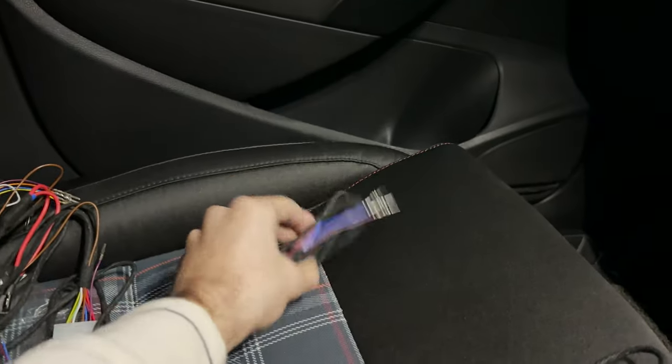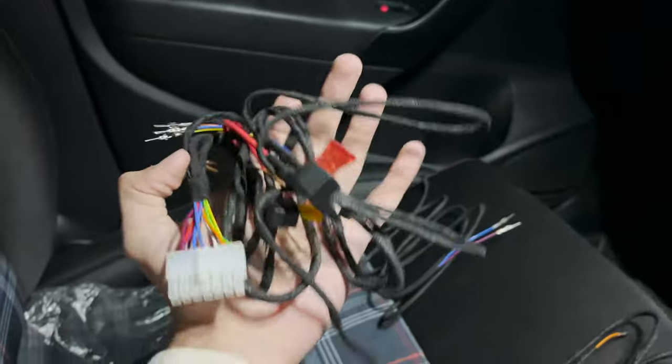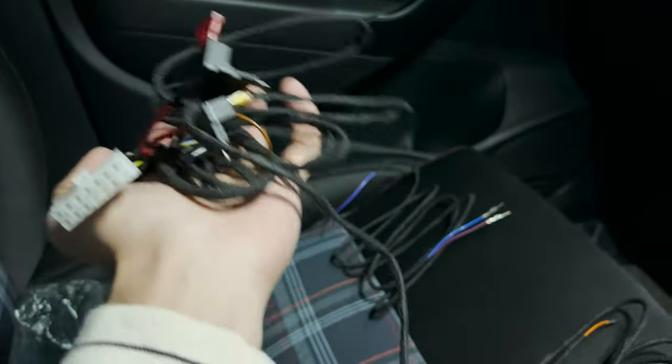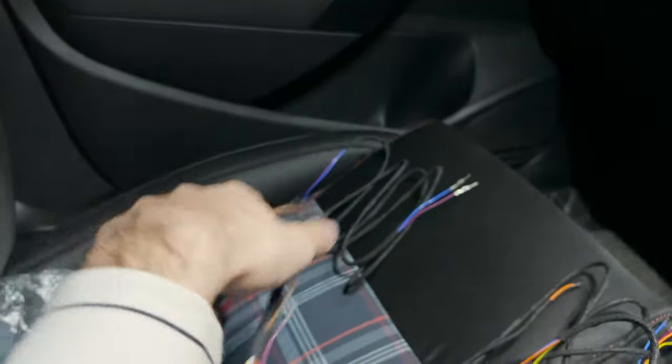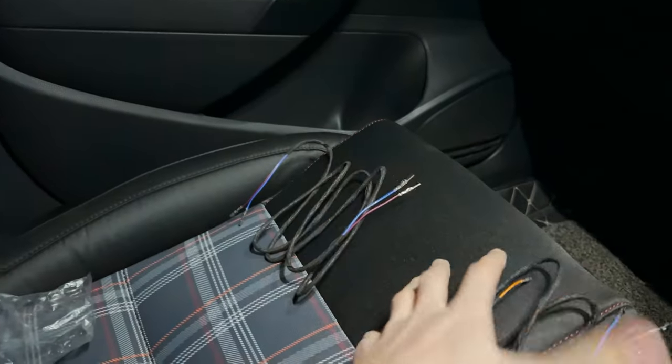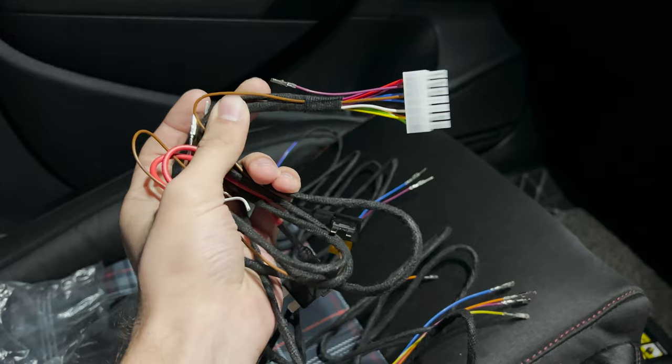This is for the passenger door. So once you open that door, this wiring needs to go inside of there to the door connector. And this is the main wiring that leads to the module, gives power to the module, goes to the earth, and connects to both of the doors as well. So first we need to open the door cards and lay down this wiring, and then we can come back in the interior and lay down this wiring. It should be pretty easy.